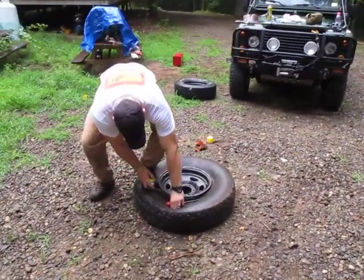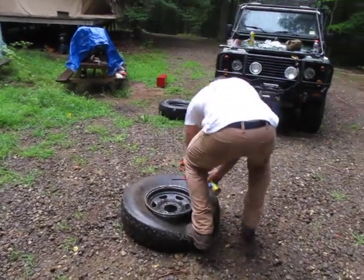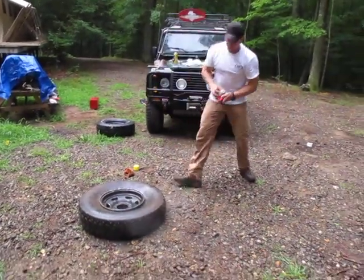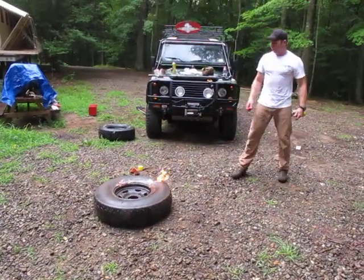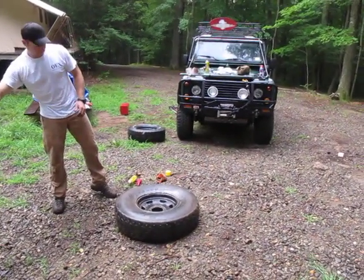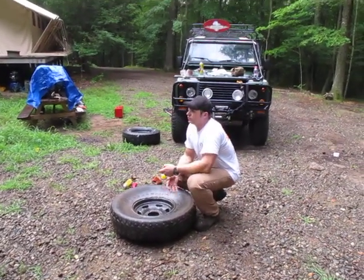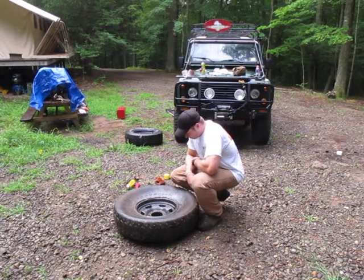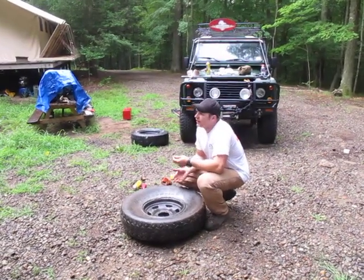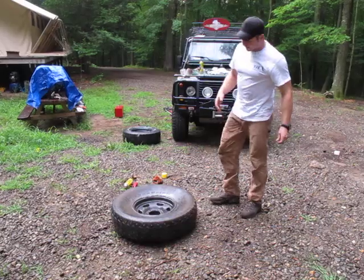What I need to do is I need to get ether down in there. As I combust, you're going to see it create a vacuum. There's your vacuum. Air is going to be drawn in via the valve stem. There's your vacuum — you've got to wait for equilibrium. If I lit this thing on fire and nothing happens, I need to go ahead and do some force, create a little bit of air in there to facilitate that combustion. I'm going to go ahead and kick it.